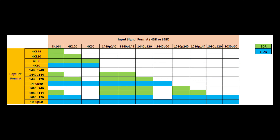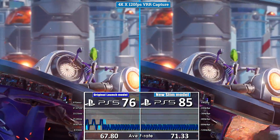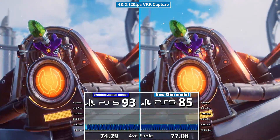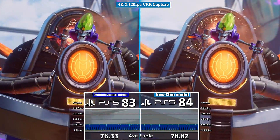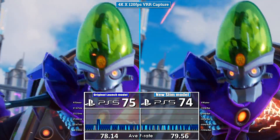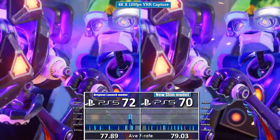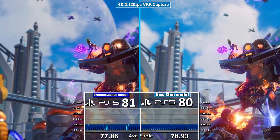The table on screen shows you the pass-through versus capture levels available, which will include HDR. A USB 3.2 port on your PC is required — you can use a lower 5 gigabit USB 3.1 port but resolution and frame rates will be limited. I worked with Elgato on this during the early review stage and they are looking to add a port check in the software to advise you the speeds you can achieve, so be sure to check your motherboard settings.